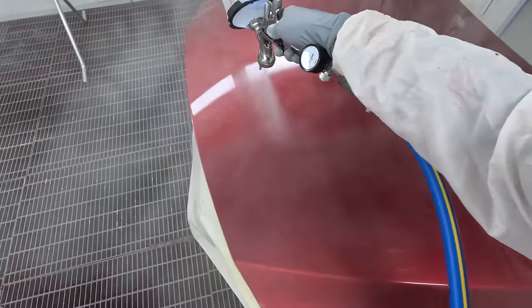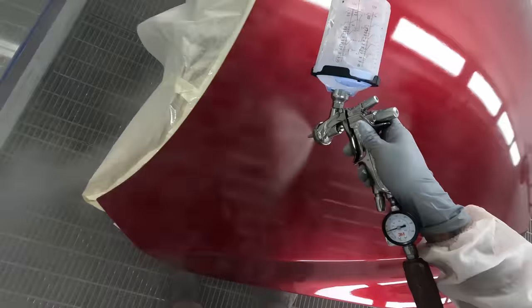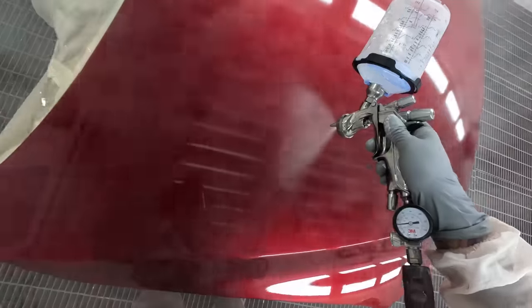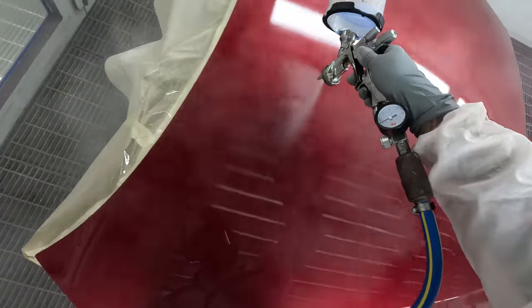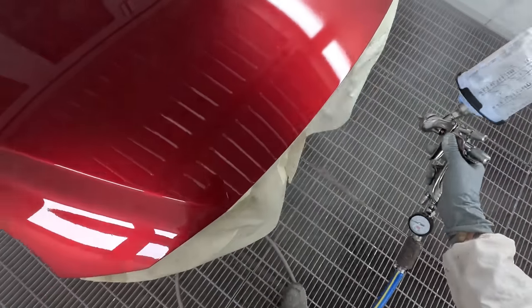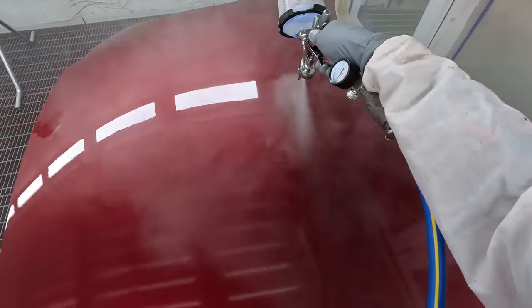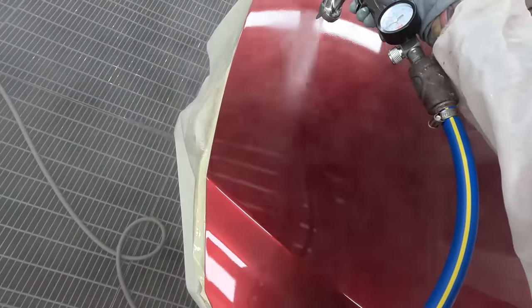On this last bonnet I just put it through its paces using the 105 clear, and again it did a wonderful job. But as always with the Supernova I am especially careful of any contours - those little swage lines on the bonnet, just hold off and don't go too heavy because it will run really easily, especially with that 105 clear. As I'm watching this footage I can actually see there is still some slight imperfection in the fan - it's putting more on the top and bottom than in the middle.